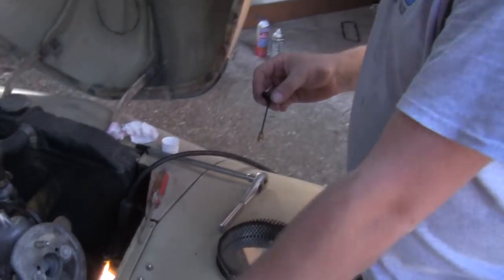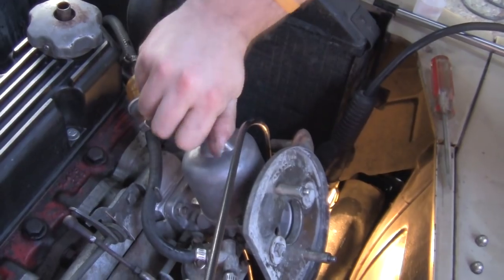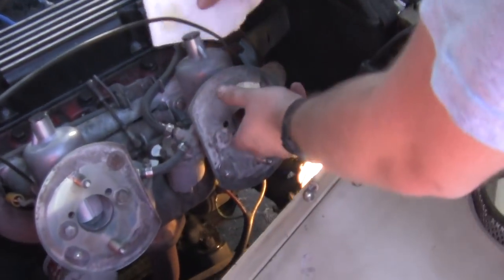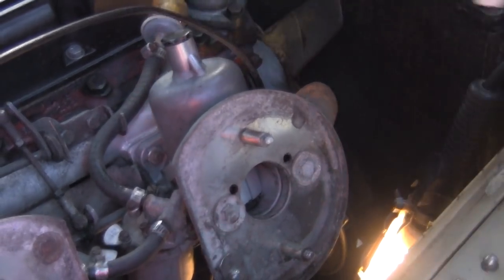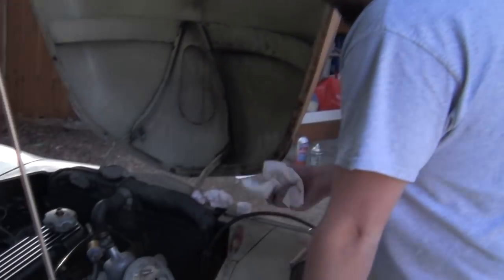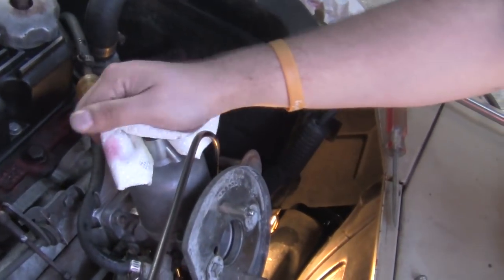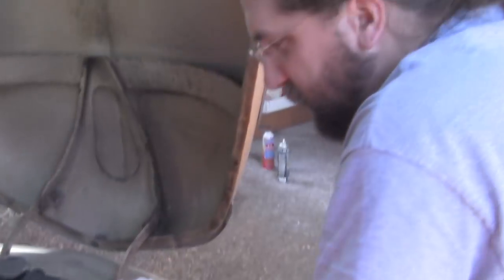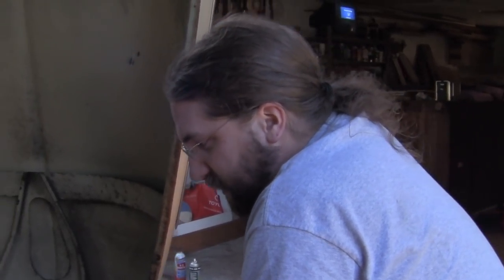When you go to put the dome back on, be aware that you can make a little bit of a mess with the ATF if you fill it just a little too much. So we'll put this back in — thread it down. Grab a rag, put it right here, and lift up on the piston. It might squirt out just a little bit of fluid. If you put too much in, the fluid has to go somewhere and will squirt out of the little vent hole. I always put a rag here to catch it so you don't get ATF all over the motor. Different oils affect the acceleration parameters. Our next step is to get our carb sync tool out — you can accomplish the same thing using a piece of hose, but I have the tool which will be easier to demonstrate.